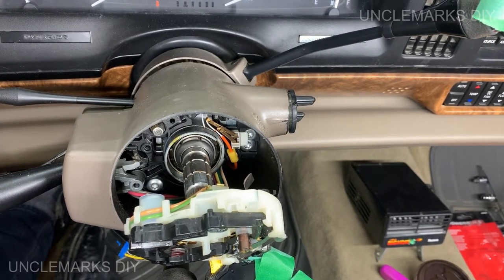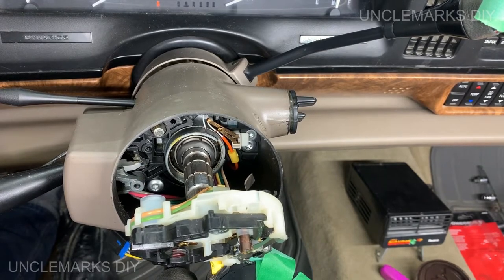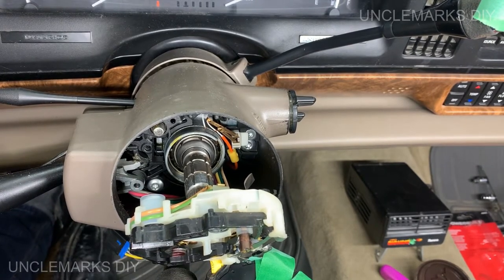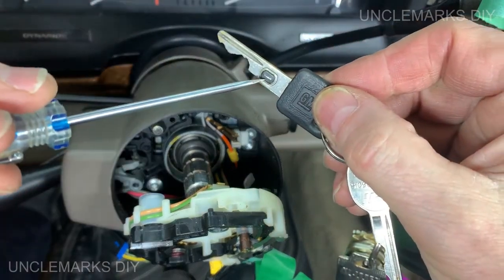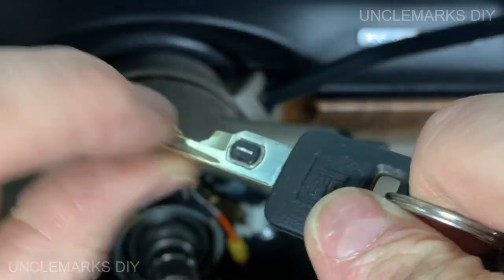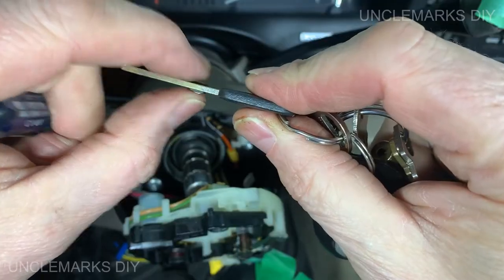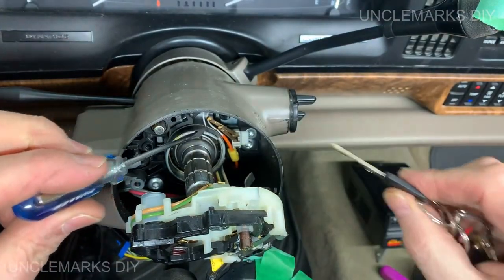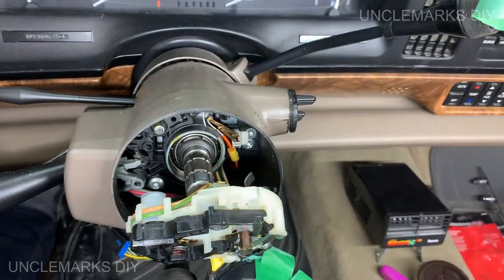Where are my keys going now? If you look at your keys, you have that little pellet in there. The pellet's actually a little resistor. If you measure from both sides, you should get a resistance. I think there were 16 different types of these pellets. So somebody measured that because this broke and didn't want to go through all this trouble, and has put in that same resistor.